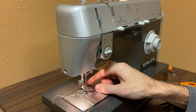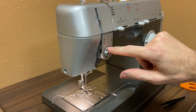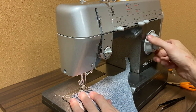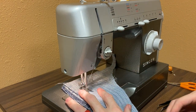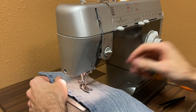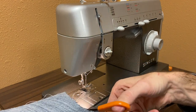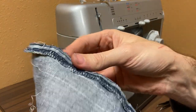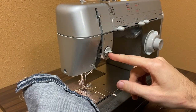I don't know what's up with this foot. It's super wobbly. But they've got the 2, 3, 4, 5 highlighted on your tension gauge. That's probably your typical running tension. So, I'm going to go up to a 5 millimeter stitch and we'll just see what happens. So yeah, that's much better. You can see pre-tension fix, and then this is on a number 2 tension.